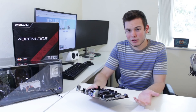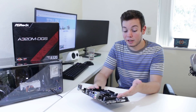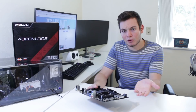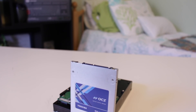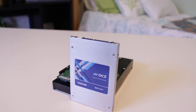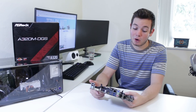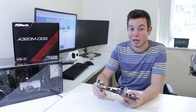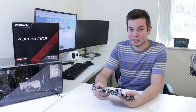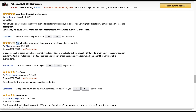In my system I just use the 16x PCIe slot for a graphics card and the Ultra M.2 slot, both of which worked perfectly fine on this board. I don't have many SATA drives — usually only one at a time — so the four SATA ports weren't limiting at all. Overall this fit my needs, but there was no room for future expansion, and not being able to overclock felt like a significant hindrance — roughly 10–15% free performance that could easily be attained from the R7 1700 on a decent B350 board.